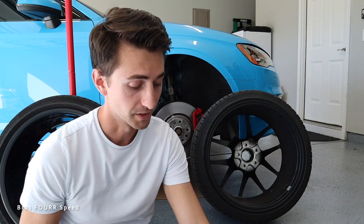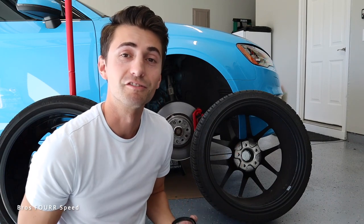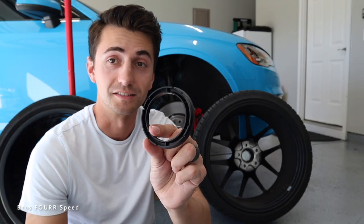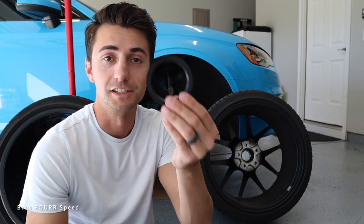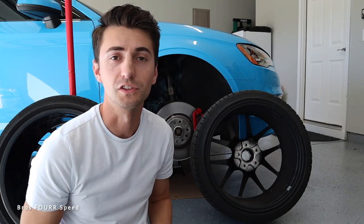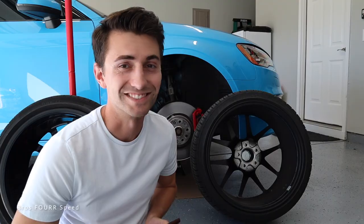That's what I did with the Audi to solve the vibration. Quick video, but I wanted to mention this because I could not figure it out. I checked the Audi forums and barely anyone talked about hub centric rings beyond saying 'make sure you have good ones.' So I'll add to that: don't get hollow plastic ones. Solid is the way to go. Quick PSA for those doing aftermarket wheels — solid hub centric rings are at least one way to solve a vibration. See you guys in the next video.